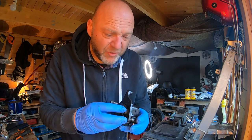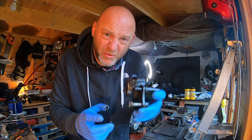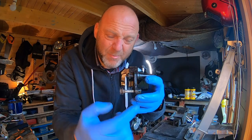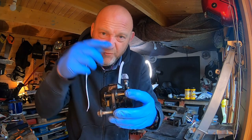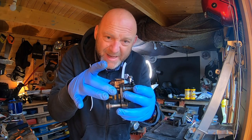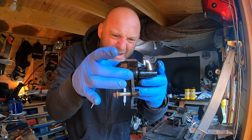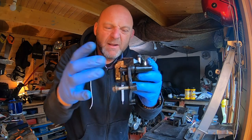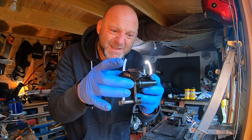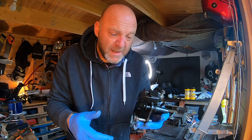The rubber seals are all on. Quickly, for those who don't know: this is a caliper — it sits on top of the brake disc and the disc goes in between the two sets of pads. As brake fluid is pumped by your hand it pushes the piston across, pushes the plate across, and squeezes the two pads together. We bring this out slightly, the disc goes in between, the pads are pushed together, and this part here stops the pad from dropping off on the inside.